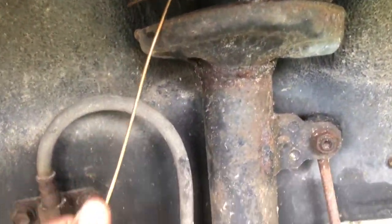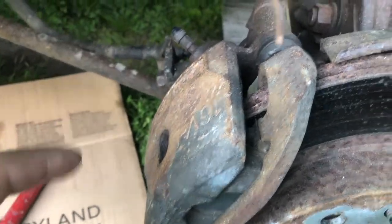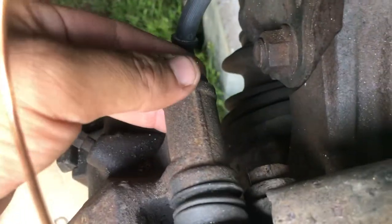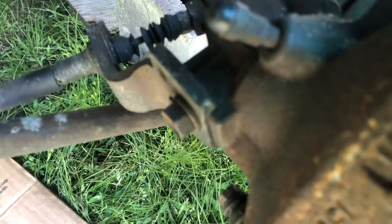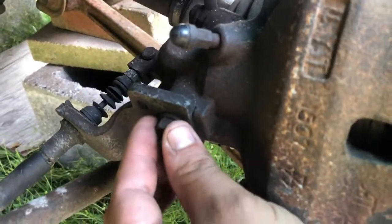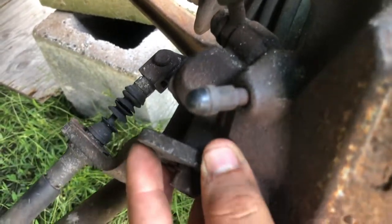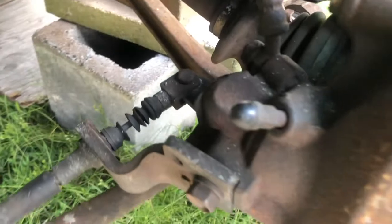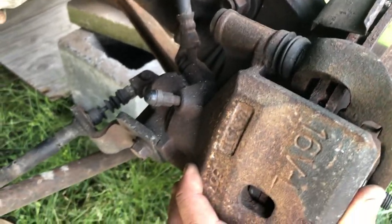I have copper wire that's going to hold the caliper up in the air. The way this comes off, there's only one nut you have to undo — there's no nut on the other side, that's just a swivel joint. I'll use a 12mm socket to take off this mechanism, and then undo the other one, which I think is a 13 or 14mm bolt. You take off this bracket and the cotter pin, pop the pin out, and this disconnects from the caliper — that's how the e-brake mechanism works. If you're just doing rotors and brake pads, you can still do it without taking those things out.